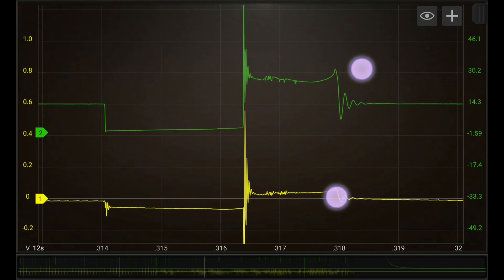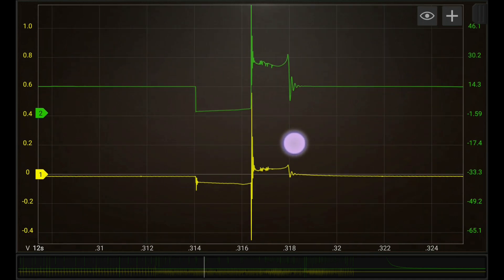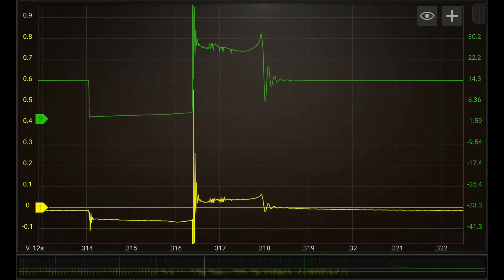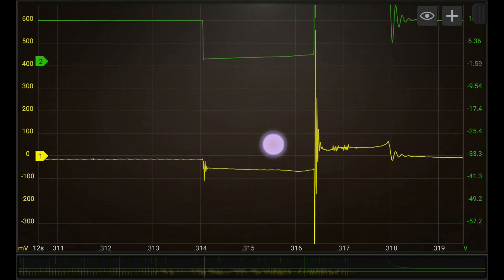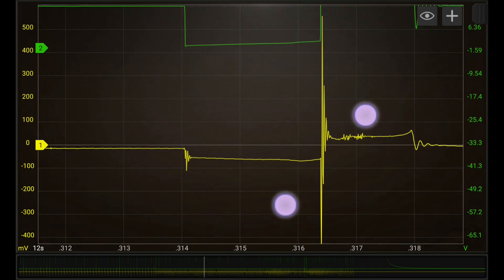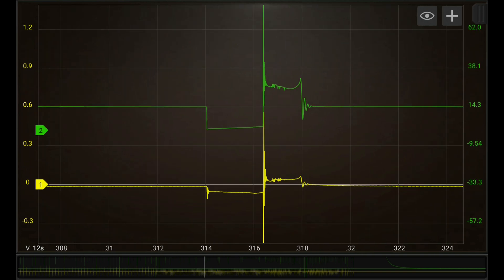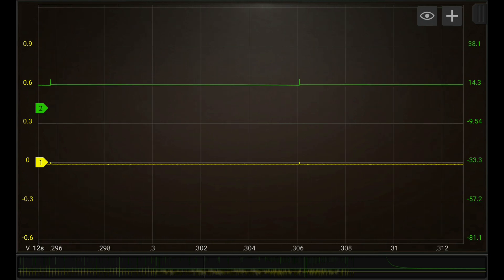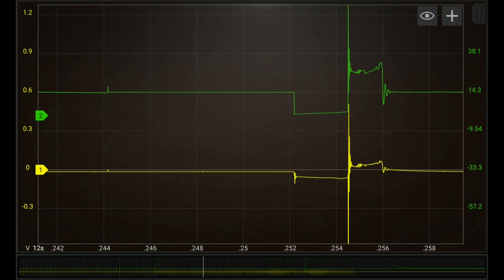It looked very good live on the oscilloscope too. I do wish I would have recorded that because I really like seeing primary and secondary together — you see how much information that gives you. It's telling us the same thing. It's not necessarily telling you how it's being pulled down to ground in the primary while watching the secondary, but you can tell a lot from either one of them. As hard as some of them are to get to, and as insulated as some of these coils are, if you can just get the primary, you do get the same signal.